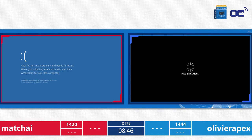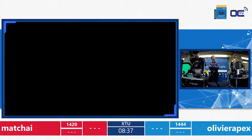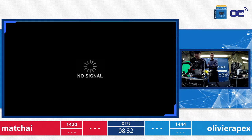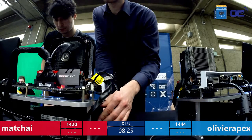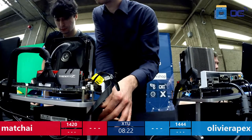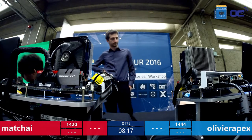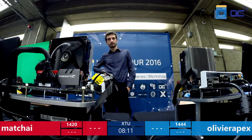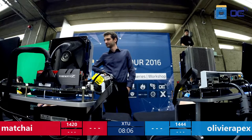Another question that we had, from Transmit and Niven Lechov: what would you say is a dangerously high CPU temp? Well, for my daily setup, I want to stay, no matter what the load is, around 80 degrees. You have to think, if your CPU is at 80 degrees, the cooler maybe dumps the heat inside the case, so all your other components will get hotter as well. And is it useful to overclock your setup to 4,500 or 4,600 megahertz? I think for gaming it's not beneficial. Your overall performance will be better, but you will not get a 5 frames per second increase by overclocking your CPU another 100 megahertz.